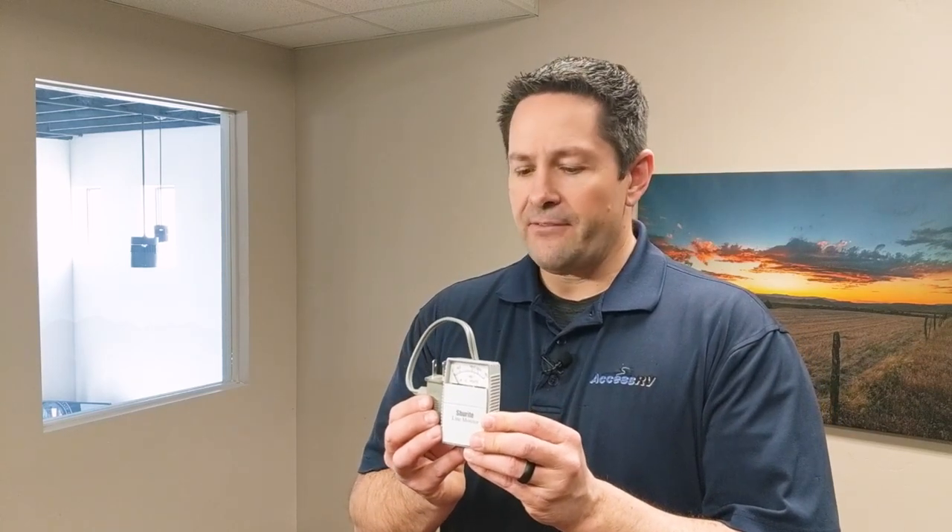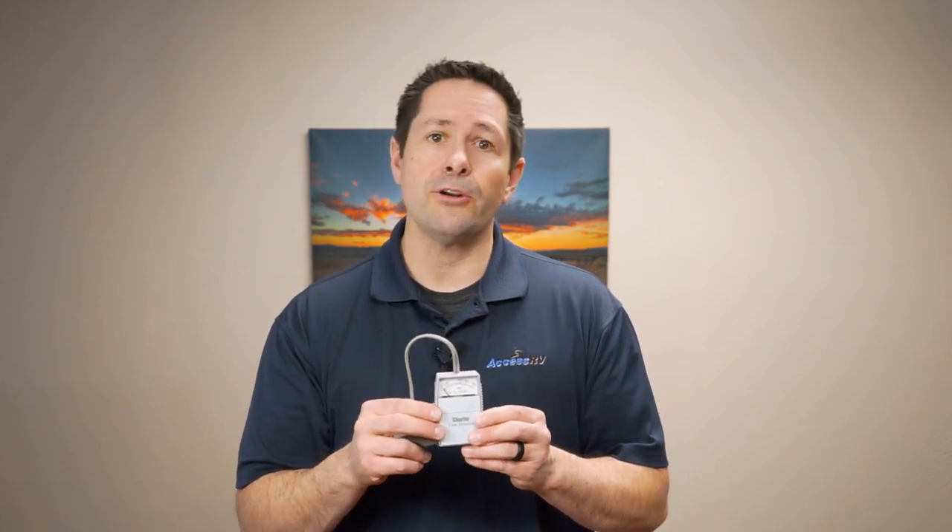You may also want to check the voltage on the 110-volt side of your RV. This little analog meter plugs into a receptacle and a bar goes up and down showing your voltage. Again, a multimeter accomplishes the same thing. For the 12-volt side, this tester plugs into a cigarette-style lighter plug and gives a digital readout of your voltage. When you drop below about 11.5 volts, your batteries are getting low and it's time to recharge them.